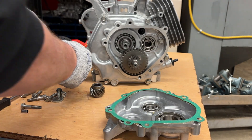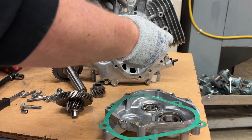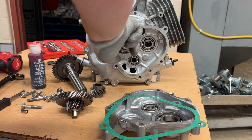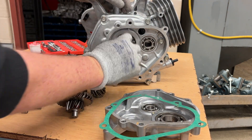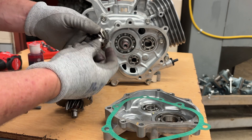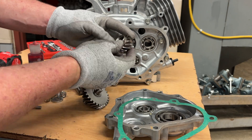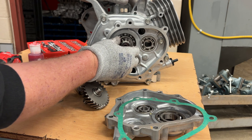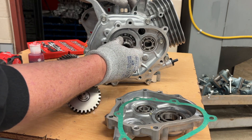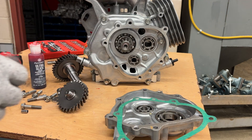This one is going to go in here and be on the drive shaft. They've got bearings on them, but we've got metal to metal, so we need to do some assembly lube on the end of the crankshaft. These are called splines. Remember, if they came off kind of tough they might go on a little rough too. The splines are on the outside edge on this side — you want the splines facing out. If it doesn't slide on real easy, take it off, rotate it a few teeth, and check to see if you can get it to slide on nice and easy.